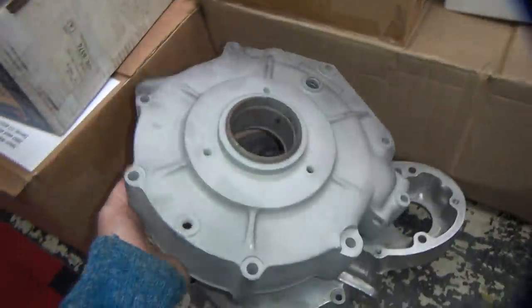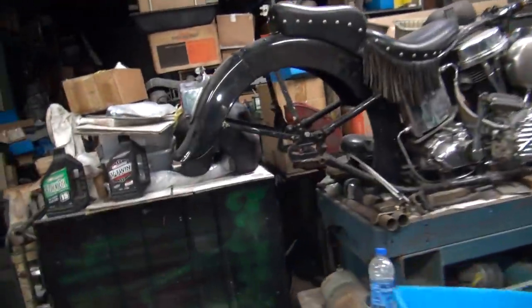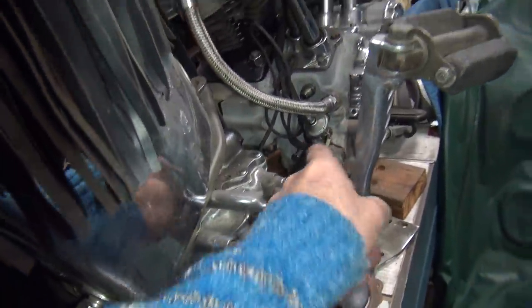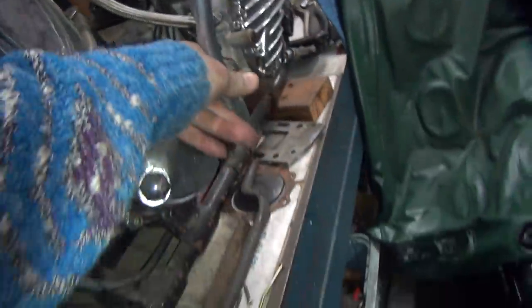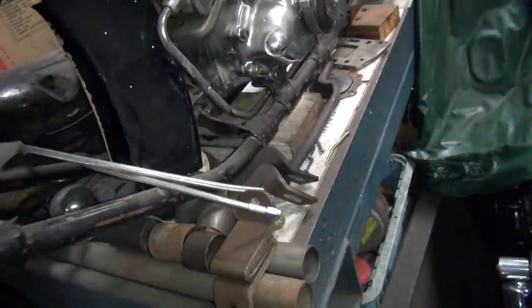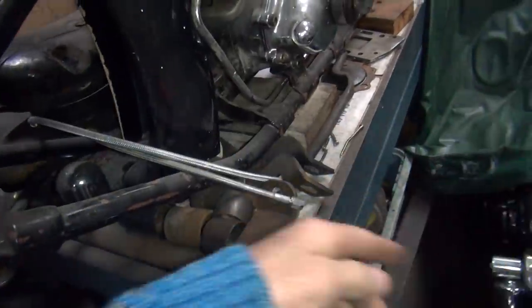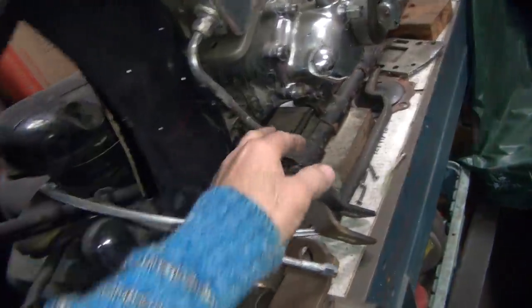The breather hose on your bike needs to go someplace. On a real Harley with a rigid frame, you come out that hole back there - that's the breather. You have a hose on that and you can either dump it right on the ground, which means air turbulence on the bike and oil goes everywhere, or you take a hose and run it all the way back to the back of the frame and shoot it out backwards. Most hoses have a curve built into them - you put the hose where it blows out at a 45-degree angle, underneath the exhaust pipe. Going down the road the oil blows out to the right side, not on your tire.